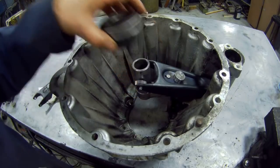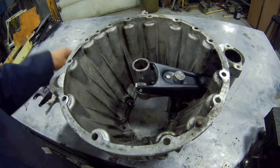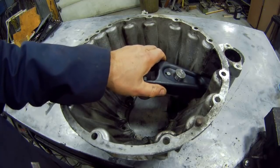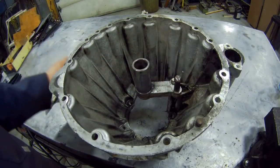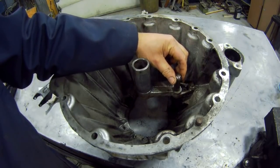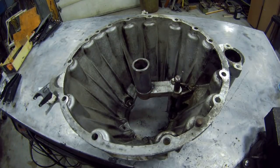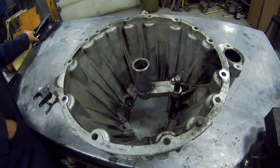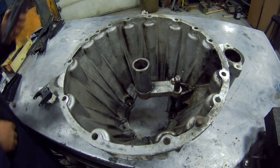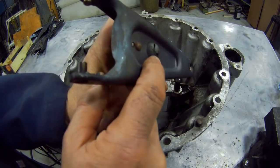There are a few things to check before you put the clutch in, because obviously we don't want to do this two or three times — once is bad enough. Just check this arm, because as I say, that one is no good at all — that's a piece of scrap. Let me have a wander and see if I can find that other one. Oh here it is — you can see how the ball is just about to push through the hole; we've just caught this one in time.